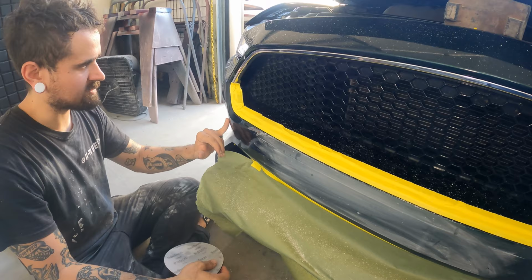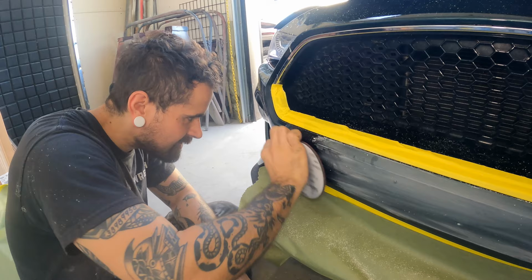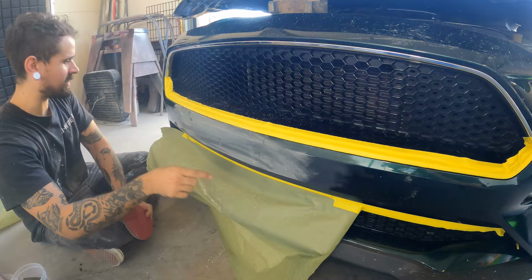it makes me feel a little bit better at the end of the day, knowing that there's actually some sand scratches under there, as opposed to just some compounding. I'm sure you can get away with doing it with just the compound, but I've never liked just doing the compound. So we're gonna do 800, 2000 in this area, and then 3000 in the edges. So I'm gonna 2000 all the way up to about here on that side as well.